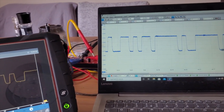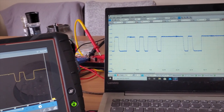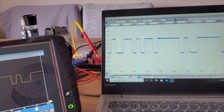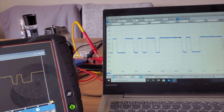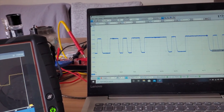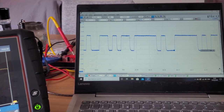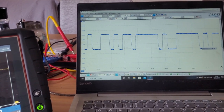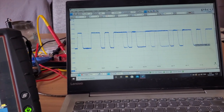There are communications that are coming out that are quicker than CAN bus and FlexRay, and whether the Snap-on machine can keep up with them, I'm going to say they can at the minute. But the Pico, without question of a doubt, at 5 million samples per division, is rapid, boys. It is rapid.